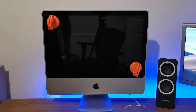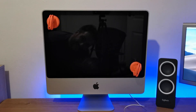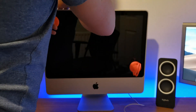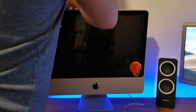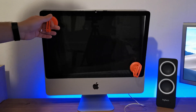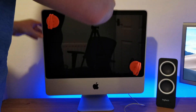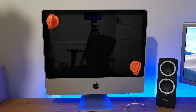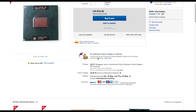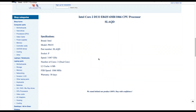Something unique about this iMac — and this continued through to end of 2011 — is that the display glass is held on with magnets and can be popped off to access the internals. There is a gap between the glass and the LCD, and you do have to remove the LCD as well to get inside. But despite those obstacles you can do the SSD and RAM upgrades within an hour. You could also upgrade the CPU to a 3GHz dual-core processor for around £15 or about $19 USD, though getting deep enough to reach the CPU is a little tricky.